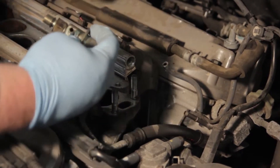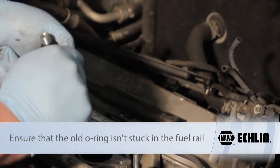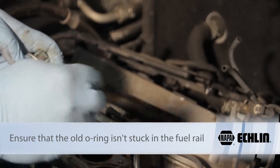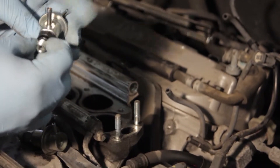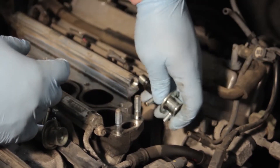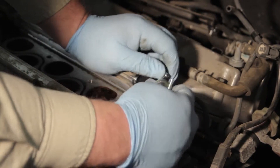The regulator comes with an o-ring and a sealing washer. We're going to remove the protective caps off the new one. Use a little bit of fuel to help lubricate the o-ring. Make sure we've got the new o-ring in place along with the sealing washer, and we will gently thread this into place on the fuel rail.